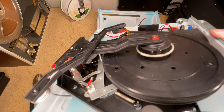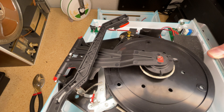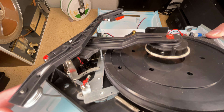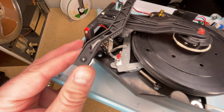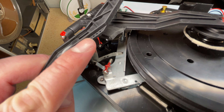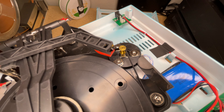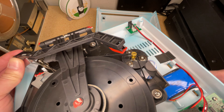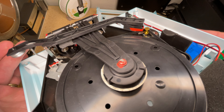It's a very unique mechanism. It's got this tone arm here — everything is not designed to be seen, it's designed to function, so those unfinished surfaces are a little different than what you're used to. This is the tone arm; it is counterbalanced. You can see these little holes right here — there was a spring that connected those two holes on that bar to one of these, and depending on the angle you connected it, it would increase or decrease the stylus pressure. This is a typical Chuo Denshi-type ceramic, which is fine — it should track about five or six grams.